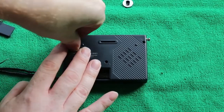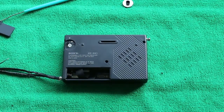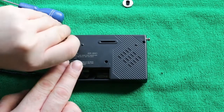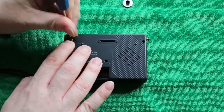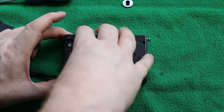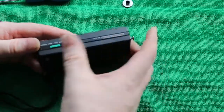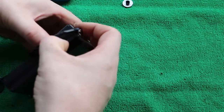I'm using a dentist pick to gain a bit more access to the sticker itself. The back cabinet is held with clips all the way around. If you carefully run your fingernails down the sides of the cabinet you can take these apart reasonably easily; if not, you'll need to use a spudger. A firm but gentle pressure and the back will come off.